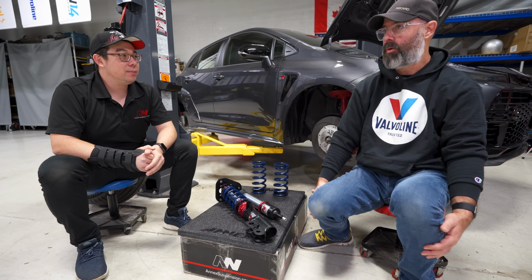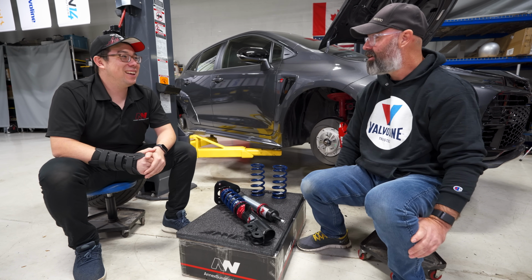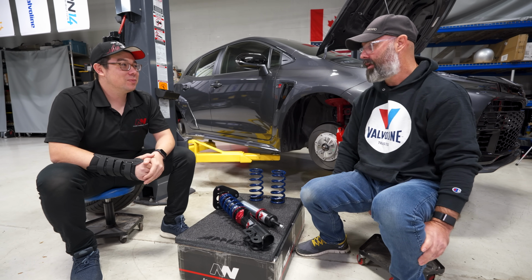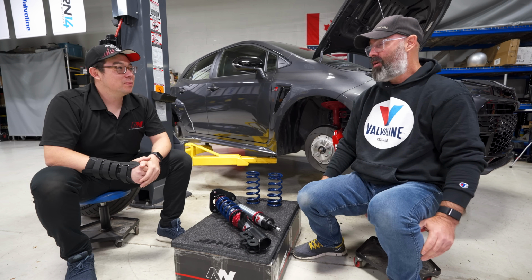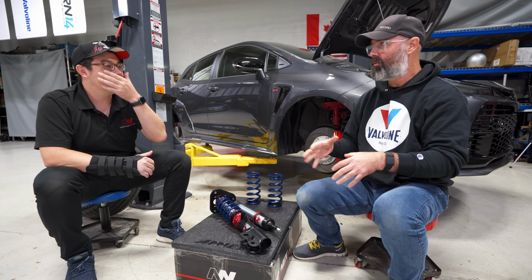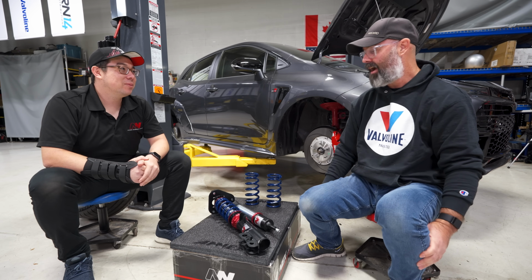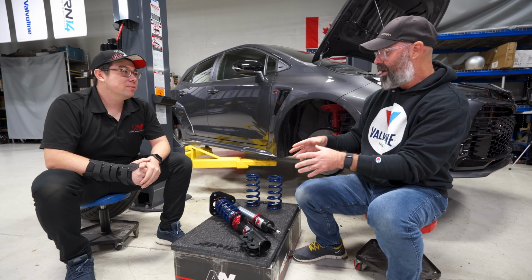I ran triples on my Canadian touring car back in the day, and it was a blessing and a curse, because it's very easy to get it wrong and you can spend your whole weekend chasing it. But if you get it right, it is amazing how it can dial in the car's behavior. For the average user, I think you have to be a hardcore motorsports guy and really be willing to spend the time to learn how to use it, and the money, because it can be complicated and you can definitely chase your tail on it. I personally like the simplicity of a single adjustable, as long as it's damped well from the start and matched well with the springs.